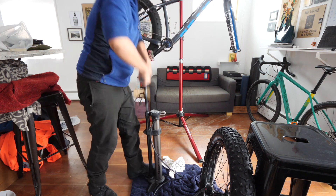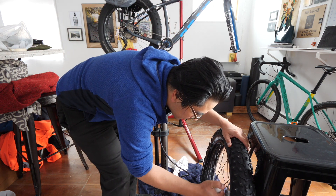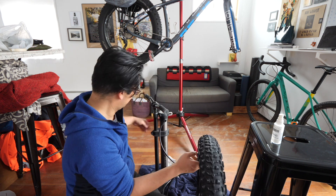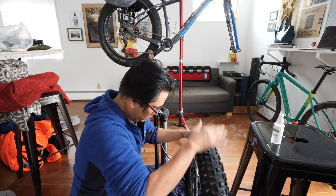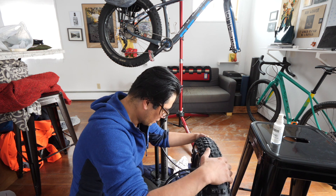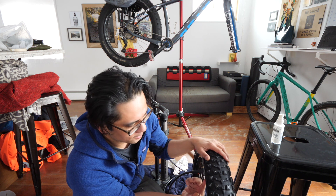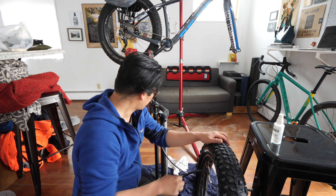Pump is all charged up again. What I suspect is happening is that there's just a little bit too much of a gap for this to seal. It's just what I thought — because this got on so easily, there's too much room between the tape and the tire. So I'm gonna have to add a couple rolls of tape. Let's pop the tire off and add some tape.